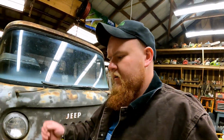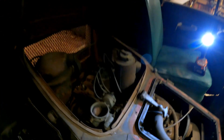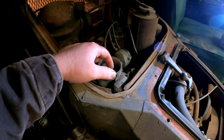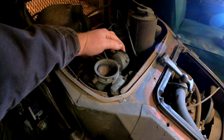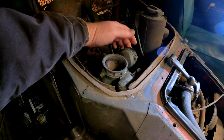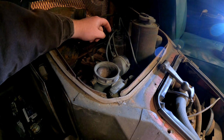we're gonna order some fuel pump, order some points, wires, all that kind of good stuff. We're gonna pull this carb off, pull the carburetor off right there, and make sure it's all right. The choke is still working because it cranks on high idle. You throttle to kick off. These points look kind of raunchy in there.